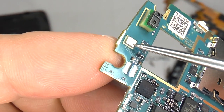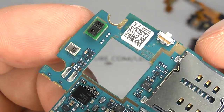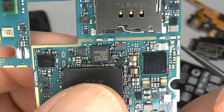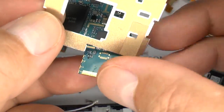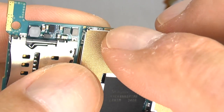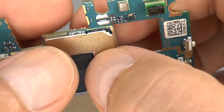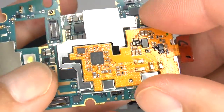This is the secondary microphone used for background noise suppression and stereo recording. Infrared LED and ambient light sensor, which doubles as the proximity sensor. Power switch. The SIM tray can only be replaced by heating up all of these solder contacts at the same time using a hot air soldering iron. If you are replacing this metal shield, make sure you line up the small clips around the outside edge and push the shield all the way down so it's flush with the main board.